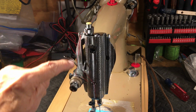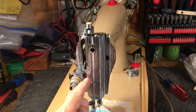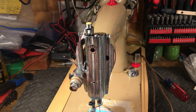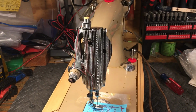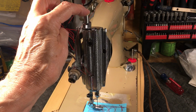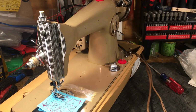It goes in here, around between the disc, around, pick up the spring, click it in the notch, take it up to the take-up lever, left to right, down through the guide, another guide, thread the needle straight through, left to right. Flat side goes on the inside, the long groove is on the outside. There's your patch-o-matic for doing darning and freehand monogramming, stuff like that.